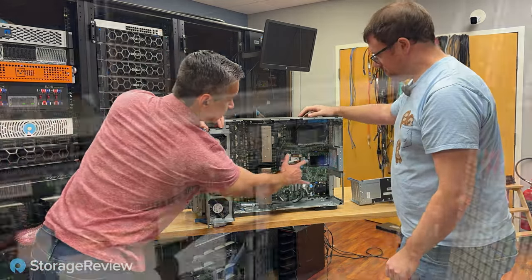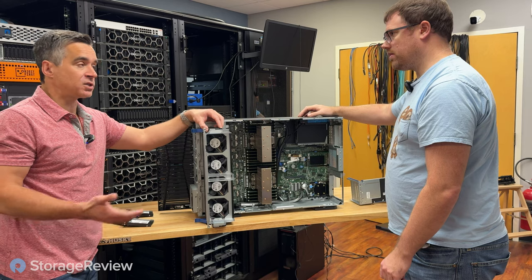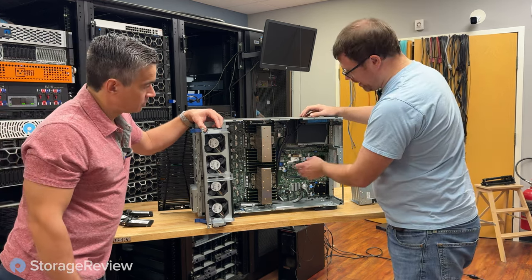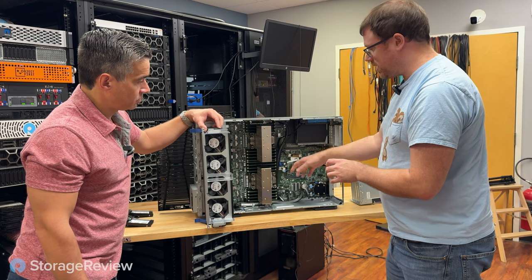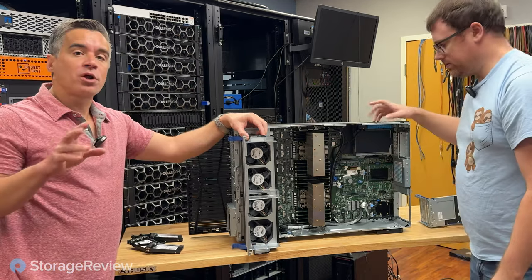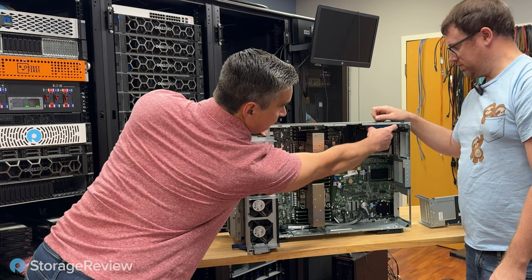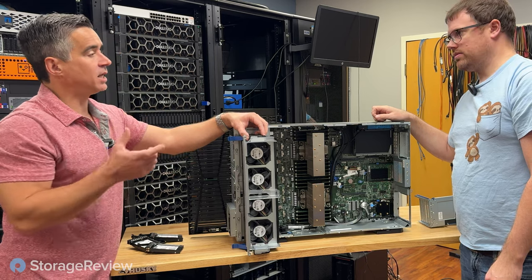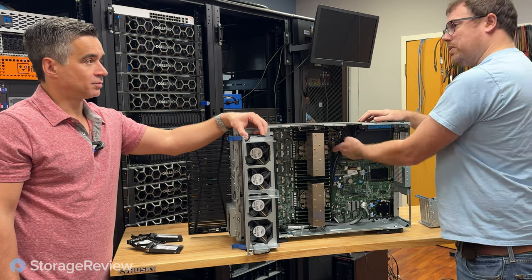As we look at the rest of the internals, we've got twin OCP slots — and that's something we're seeing a little more of. The OCP used to be just for NICs, but now they're more flexible. It's nice to see the options for how you connect these things, and the motherboard is really versatile in how it can be configured. You're providing NVMe lanes to your OCP slot through cable, so if a configuration doesn't leverage an OCP slot, you can put those PCIe lanes elsewhere. HPE also offers a little boot drive unit that can chunk in to provide rear access to the drives — we didn't get that this time, but it's a handy feature for administration. There are also internal USB headers if you want a thumb-drive boot.